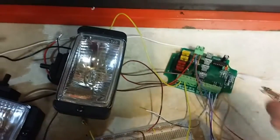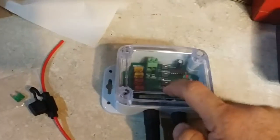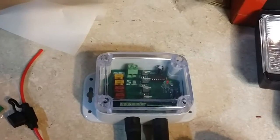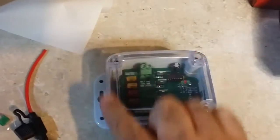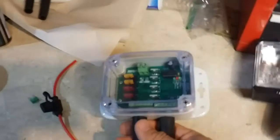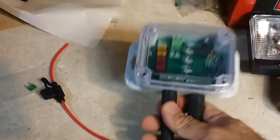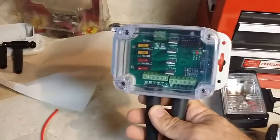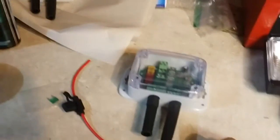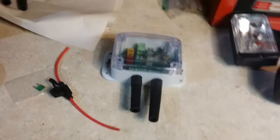While the fog lights are on, this module does not get hot at all. These are operated by MOSFETs, which are inside a sealed enclosure — except for the holes here. This sealed enclosure will not get hot because those MOSFETs do not get hot. It uses simple Phillips screws all the way around to take it on and off. I do recommend that when you mount this, you mount it on the front bumper bar of the vehicle with the boots facing downward, so water doesn't travel up. With the boots facing down, water hopefully does not go in — unless of course you drive through a lake, at which point you'll have more worries than whether the module works.